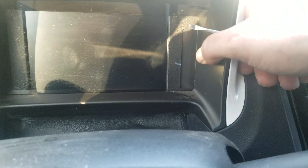You have to take this bezel off here from the cluster. To do that, pry right in there — get a flashlight and you can see a couple of clips in there. On one side there'll be another one right here. Kind of pry it open a little bit, then you'll see the clip and you've got to push that clip in and then pry out a little bit.